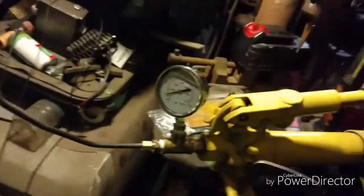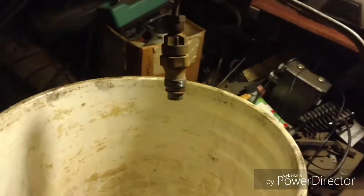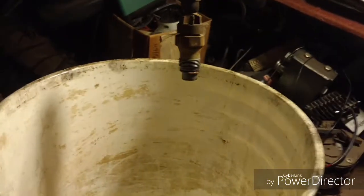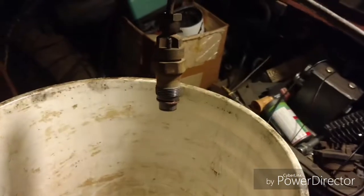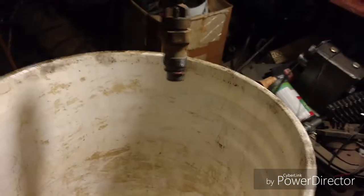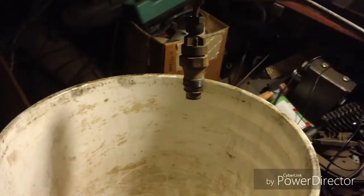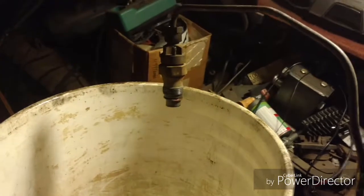It'll start showing a little pressure on the gauge, about 1,000. And I guess you're supposed to be looking for no drip. A bunch of the old injectors I've tested pumped up but never sprayed at all. But all the good ones I've been testing seem to spray really well. This one looks like it's got kind of a straight spray — the other ones have more of a wide conical spray. They shoot out a lot wider, not so straight down.